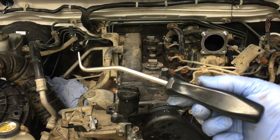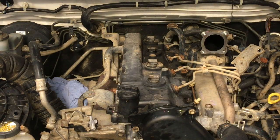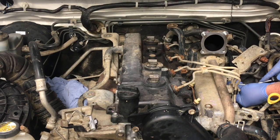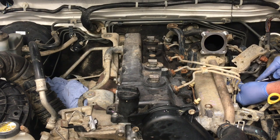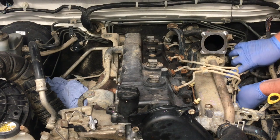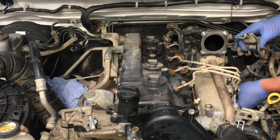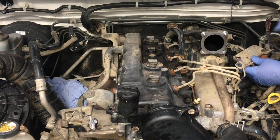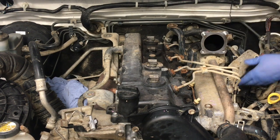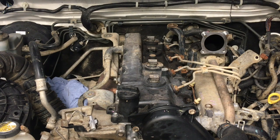So quite often what we use, demonstrated in other videos, is a tool like this, a heater hose removing tool, right? It's meant for hoses, but it also works really well for vacuum lines. You just get in there and you work it back and forward, left and right, and that'll crack the seal, and then you just bang, there it is, it's come off like that. That vacuum one can stay sitting there. Now, trying to use them there, you may rip it open, so not a good idea. So we'll ditch that to the bench.